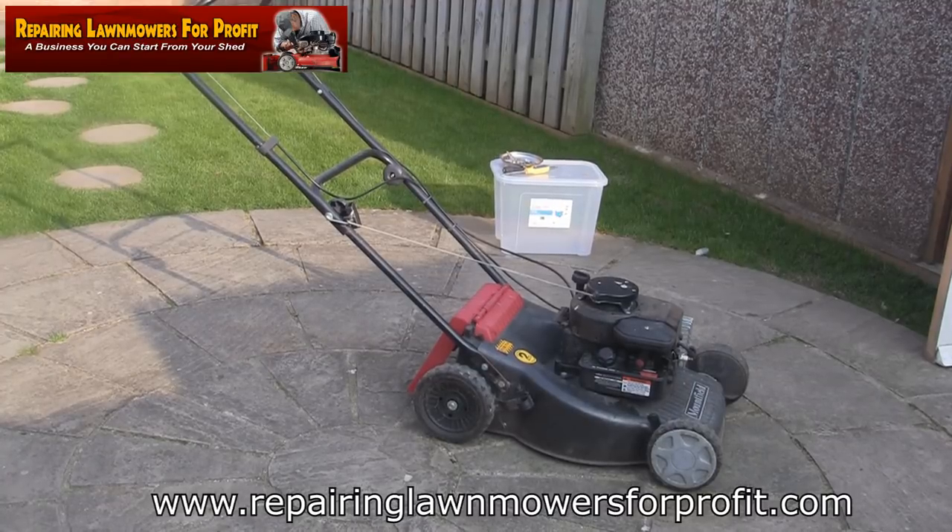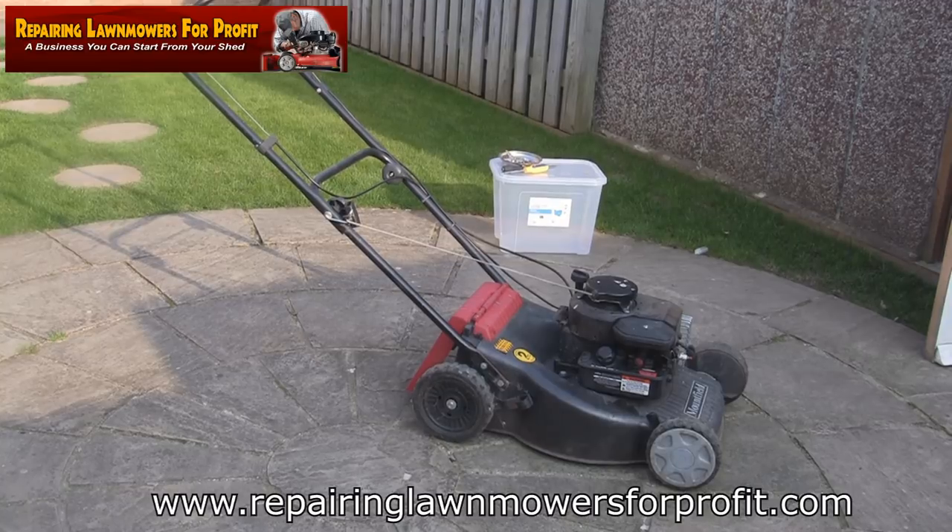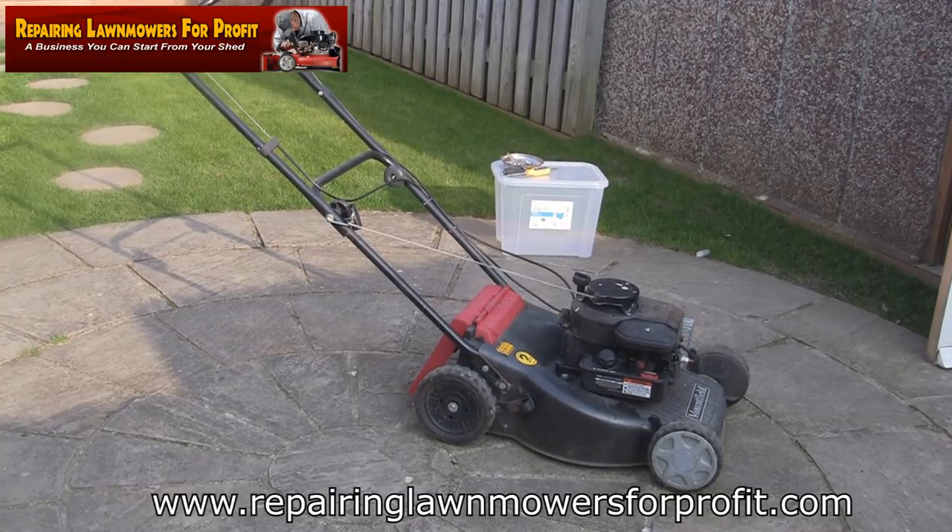So let's give this a little test - it might smoke a bit. This is common if it's been tipped up. I had it tipped against the wall with the carburettor pointing up, so there might be some smoke at start-up. But really I just want to see if it drives alright and runs alright. So I'm going to reconnect this spark plug now. Make sure you take this spark plug completely out when you're doing this repair, please.